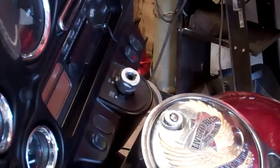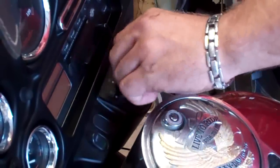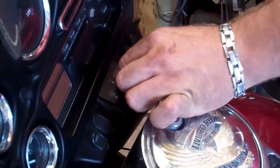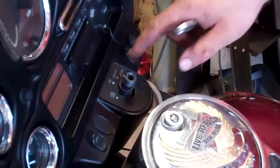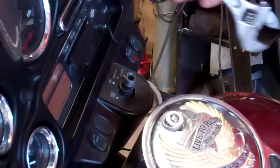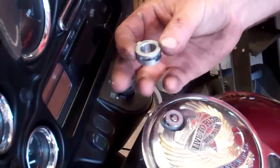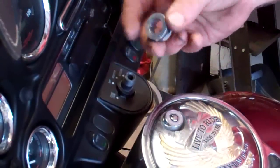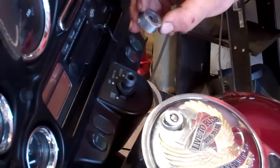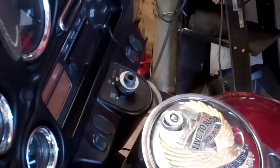The next thing you'll do is take this top piece, loosen it up, pull it off, then this piece, and this plastic piece. Then you take off this little cover and you can unbolt it and pull it out. Now, this plastic piece goes on any which way, but this one matters — this little tab, if it's sticking up, you're never going to get that ignition lock back on there. It has to be down.